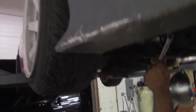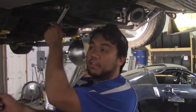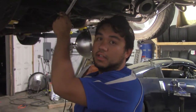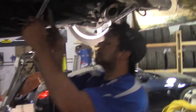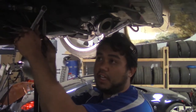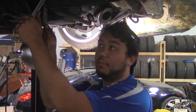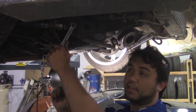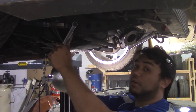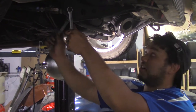So this wheel, right, this is the one that was making contact with your former fender. Yep. And probably when things are uneven length like that, from side to side, your car starts to basically do what it wants and it drives you instead. Yes. You can have things like your camber uneven, a little bit of toe out of spec, but unequal length in the arms, especially ones that go fore and aft, will make your car handle like crazy. Always make sure you get it aligned when you get that thing installed. Or you end up driving like a dirt car. Left turns only.